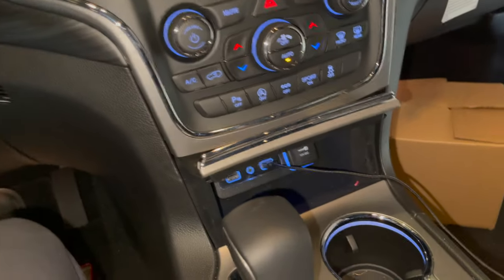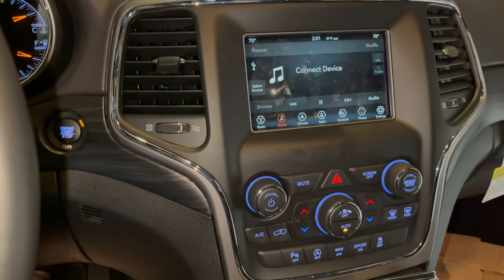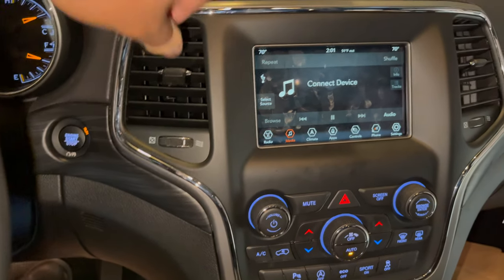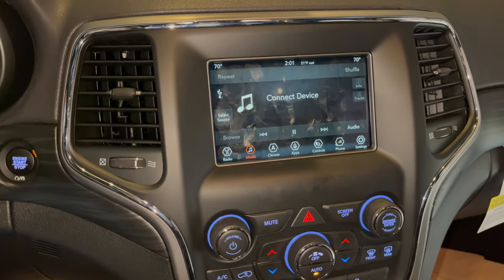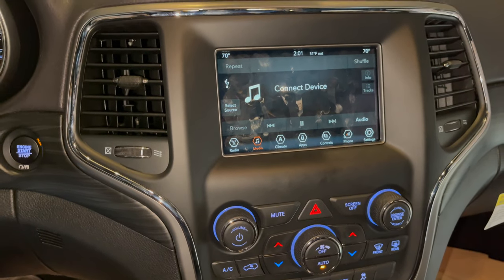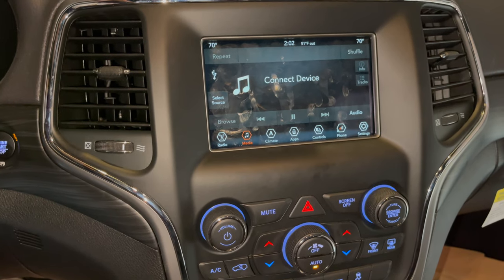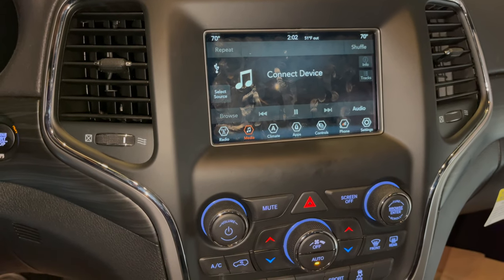You need to know where your head unit clips — this is where it sounds like it's breaking up the signal because the head unit isn't strong enough to amplify any further. For me on this unit, volume 20 sounds good, 22 is what I ride at, 24 when I want to crank it, but anything above that starts to sound bad. In CarPlay it won't go louder — I think the system knows it's clipping. I'm going to set mine for a thousand watts at the level 22, which gives me a little headroom, and since this is a 1200-watt amp being gained down to a thousand, I think I'll be fine.